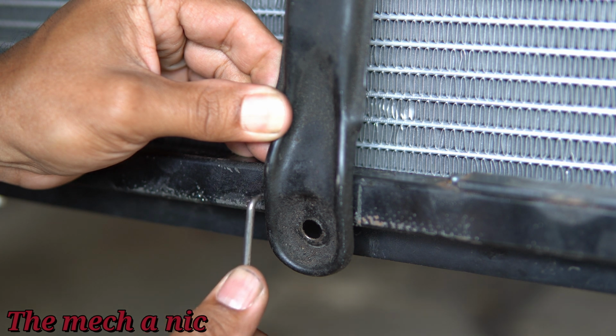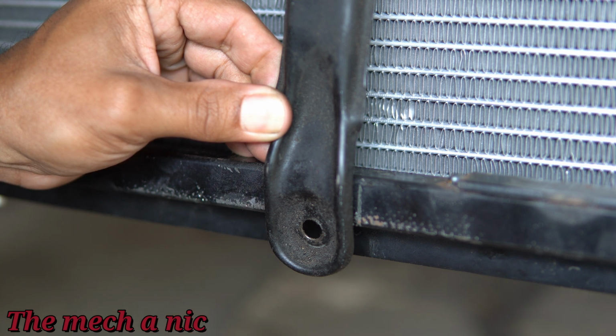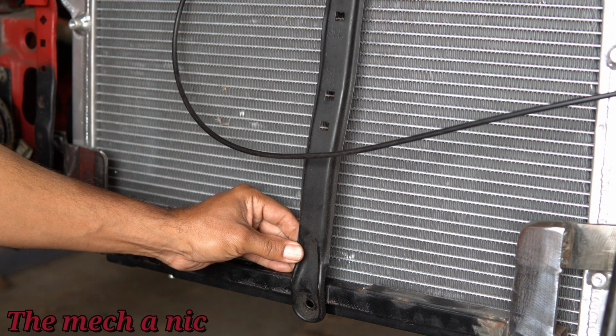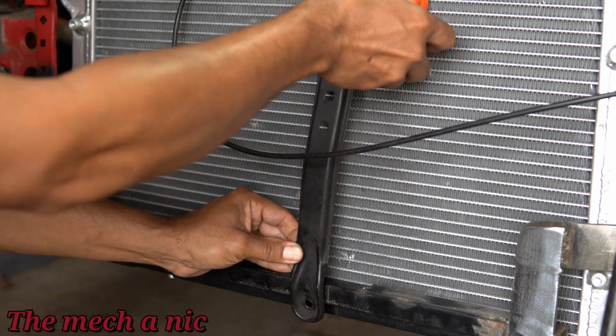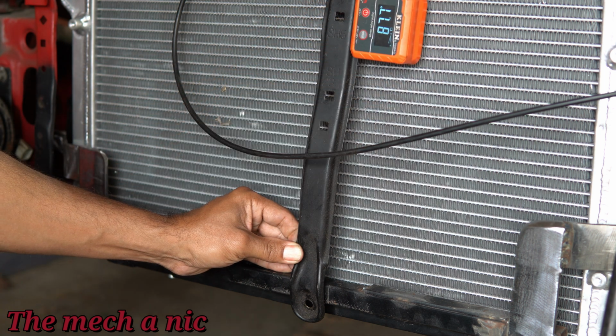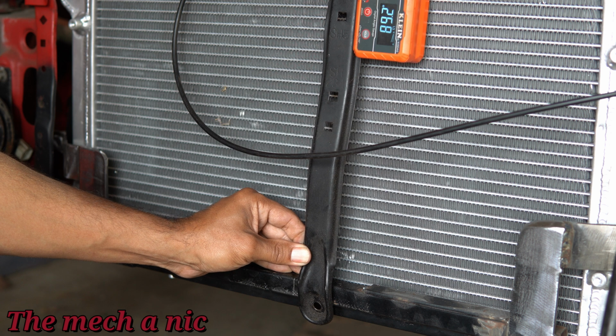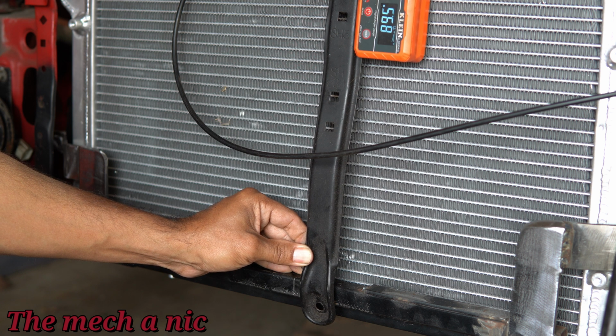So this needs to be mounted, and of course, since I changed the support, there's no mounting spot for this thing, so I have to make it. Now I made the marks right here, I scratched it out, but I'm like, hold up, wait a minute, something ain't right here. So sure enough, I put my digital level on it and it was not straight up and down. It wasn't 90. So I moved that over.